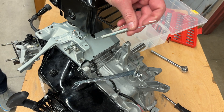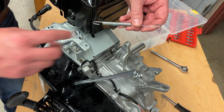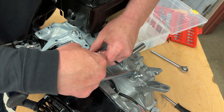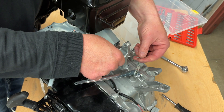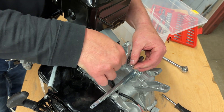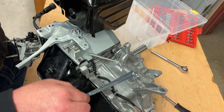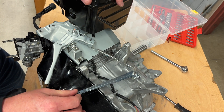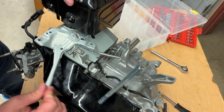My spring — this is my linkage spring. The coily part of the spring comes to this side over here and goes right in this little hole right here. Then this part of the spring goes in this first little hole right there. So now when I pull on that, it should put tension on that spring and on that governor arm. When I go this way, it's releasing the tension on that spring and governor arm. That's how that part should be working.